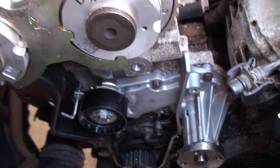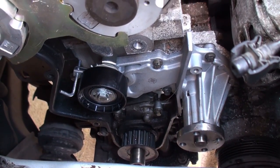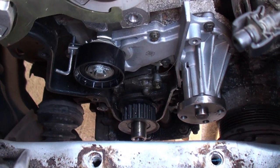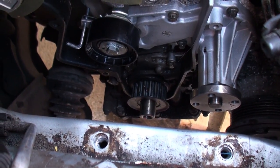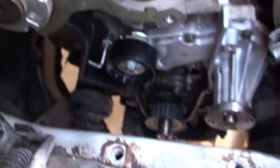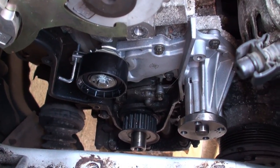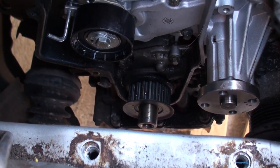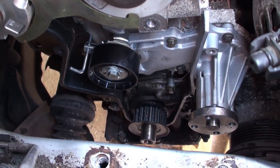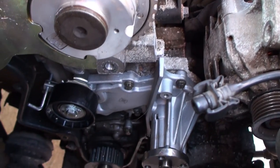The retainer is still holding the camshafts in position so nothing has moved — I can just slot that belt straight back on. Then when it's back on and tensioned, I can remove the crankshaft locking tool and re-bolt the starter in position. I think we're pretty much ready to put it back together. The reassembly video is not going to be that detailed — partly because I'm in a hurry, and partly because now you've taken it apart your imagination should let you put it back together with no problem. The one thing I have to do is tighten down that engine pulley bolt, which is extremely tight. In the manual it says there is a keyway holding that pulley in position, but there isn't — that bolt is the only thing that stops that pulley spinning on the crankshaft. There's just a cylindrical boss and a cylindrical hole in the pulley itself. Let's get the thing back together.